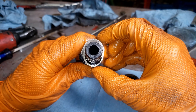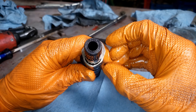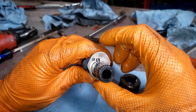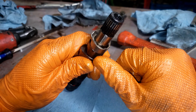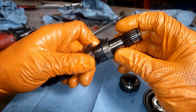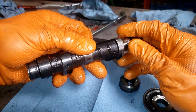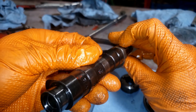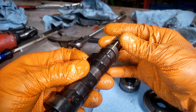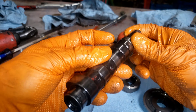And here's a good look at the main decompression. It has a spring on this side where my thumb is, a little detent on the bottom, and a detent on the top. This is the counterweight. This is the part that decompresses when it contacts the rocker. You can see that it sticks out just a little bit further than the flat part of the rocker on the bottom, unless it's in this state here. So when the engine starts, that counterweight should act to fling this out and keep it down, and you can see the bottom sits below the surface.